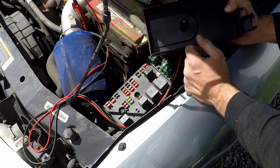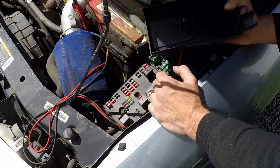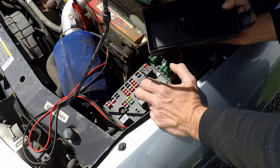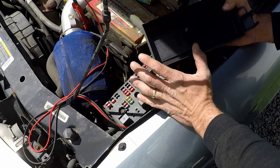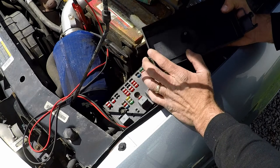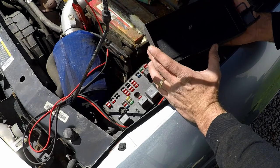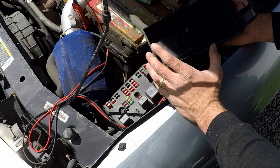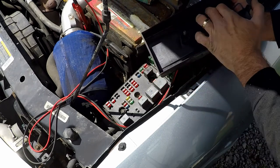And then that means that essentially when both of these circuits are running, we have approximately 16 amps of current flowing to the headlights all the time. Now, there's also other ones like fog lights, which this car doesn't have. There's backup lamps. There are parking lamps, there's another 10. For the computer to operate to run the engine, it's another 10.